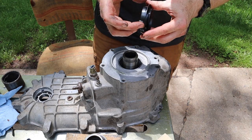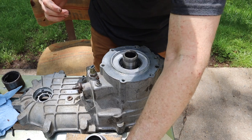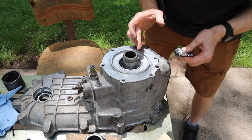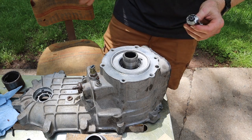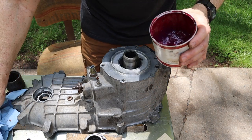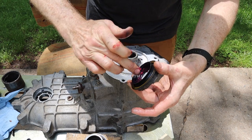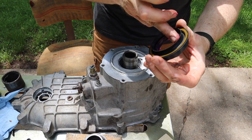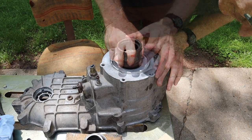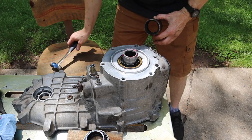All right, let's get the oil seal on. I put a little dab of RTV on this. All right, and there's an imperfection here and here. One is for me, and then one was here when I went in it, but just a little dab of RTV because that's not quite flush, all right? So what I also do is add a little grease to the inside. So a little grease where it rides on the shaft, right? All right, that's in.